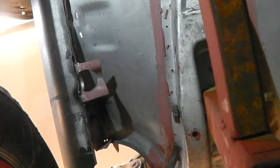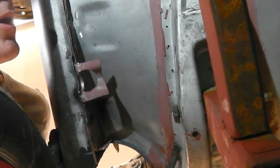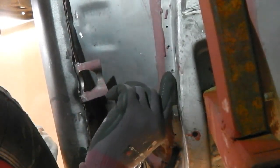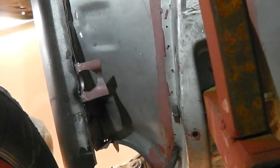So we're almost following the exact profile now, because the floor pan was never really a perfect fit, the copy pan. So you just have to do a little bit of bashing and bending. But they're almost there, you know, they're in the right ballpark, which is great. So I'm pleased about that, the fact that that's gone and drawn it in nicely. So we do two more equal ones on the other side, then the rest of the holes can be drilled into the floor pan inside the car using the spot weld drill bit, and then we'll just weld straight to that. So that's it, that's good.